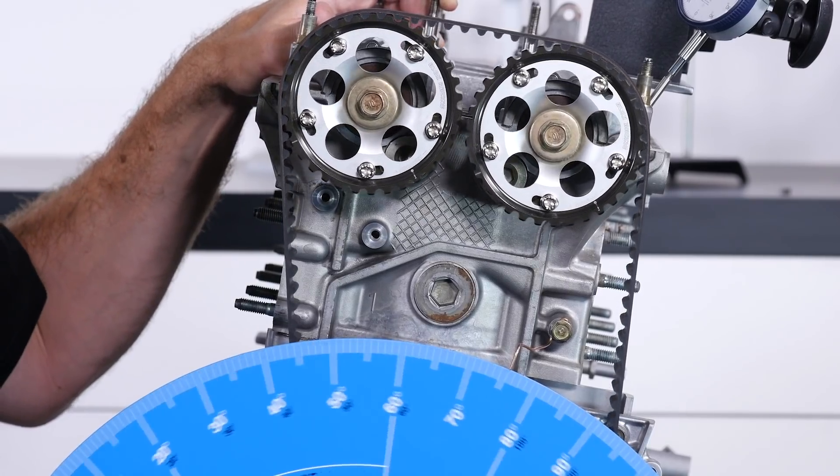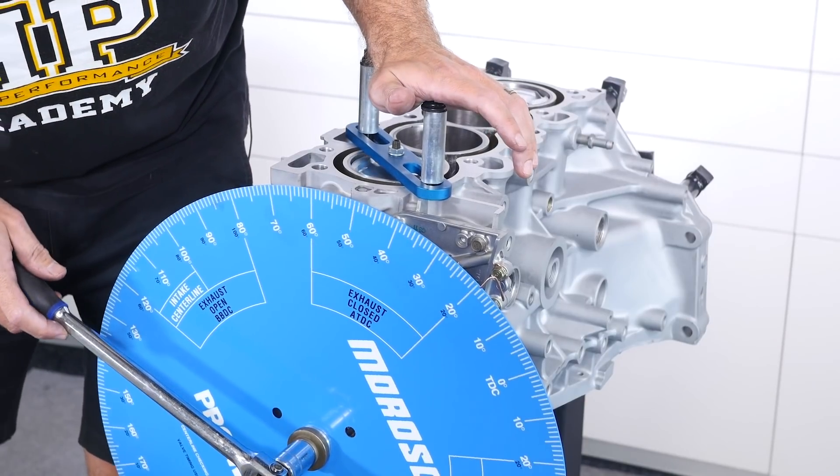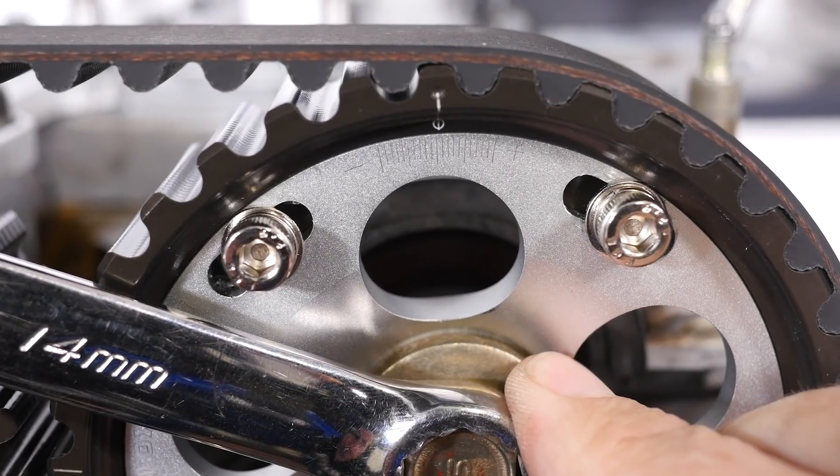There are a couple of reasons why we went down this path with the ST184 cam. First of all, when this engine was being built we were also using it as a worked example for our how-to-degree-a-cam course, and it's much easier to follow manufacturer degreeing specifications with an aftermarket cam. That's not to say the P11 cams are a problem — plenty of people run turbocharged combinations using the stock P11 cams and get great results. However, we do need to be mindful when selecting a cam profile, particularly a factory profile designed for a naturally aspirated engine, as these typically use a little more duration and overlap than what we'd ideally want with a turbocharged engine.